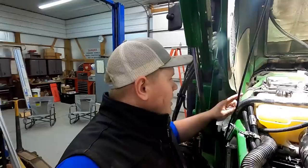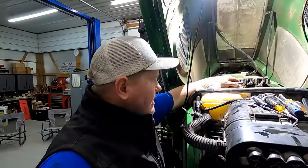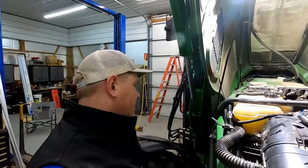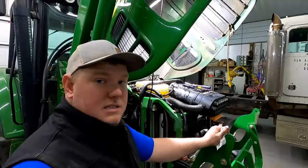There we go — we're back together other than putting the shroud pieces back on. I've got to put the cap back on and the overflow back onto it. I'm right at the max level right now, which is a bit high since it's cold outside, but I have a feeling some of the hoses don't have all the coolant in them until I run it for a little bit. I don't see any leaks right now, so we're going to fire it back up and then let it sit for the night and see if we actually got it fixed.